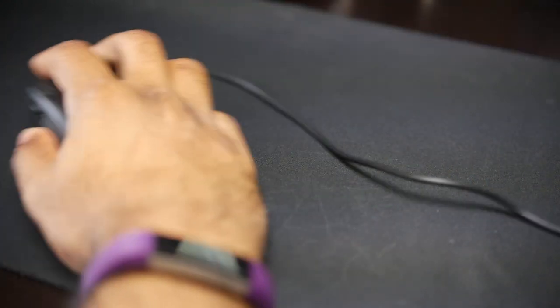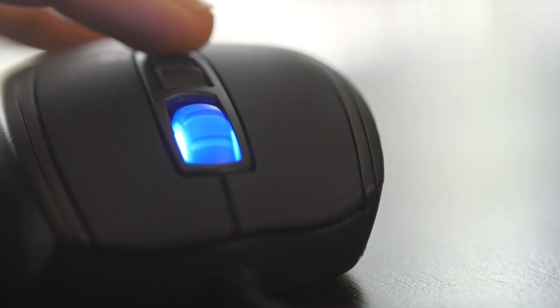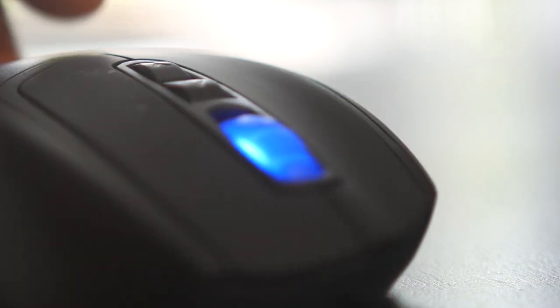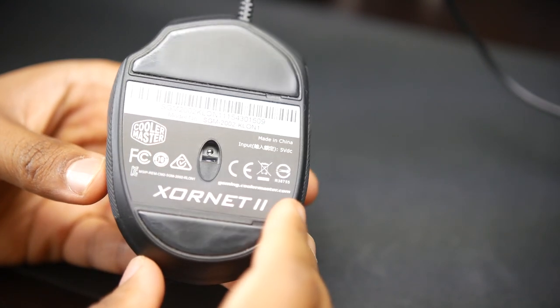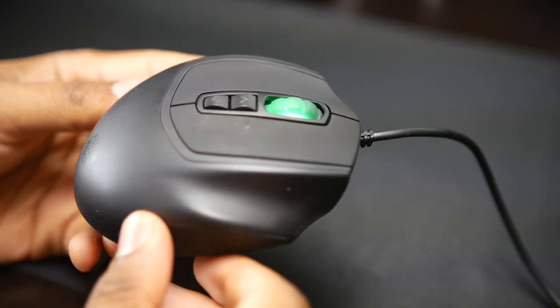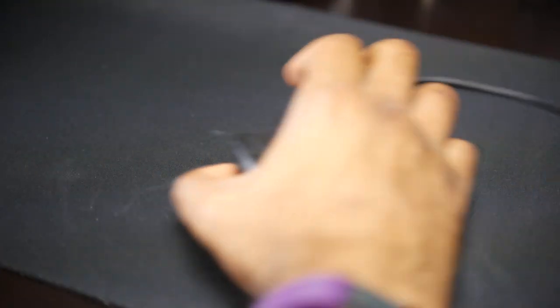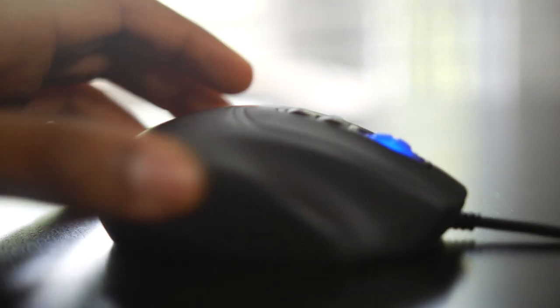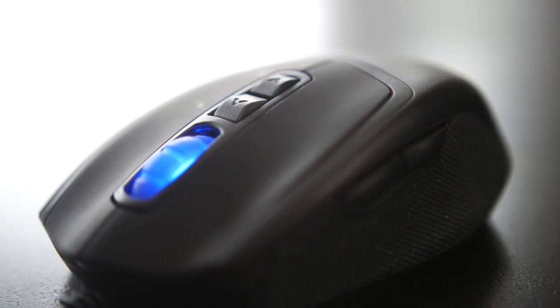There are a lot of rubberized materials all around the mouse and the sides are very grippy, making it very easy to flick around. The LED lighting options are pretty cool as well — you can switch between three different colors based on the DPI indicator presets. In terms of the optical sensor, it's using the Avago 3320 and that can go up to 3500 DPI, which is excellent for playing FPS games on the go. The lift distance is actually quite minimal at three millimeters — the sensor is really good and accurate. You also have several programmable buttons, so even though this is a compact form factor mouse it provides all the benefits of a full-size gaming mouse in a smaller, more compact package with a fairly aggressive price tag.